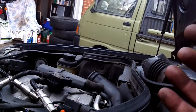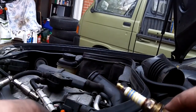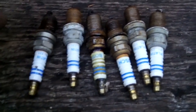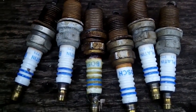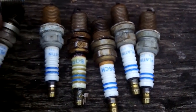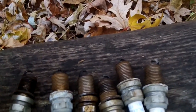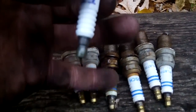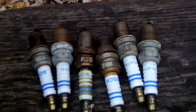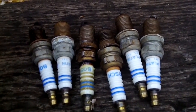I'm using corrosion preventative electrical contact grease — the stuff you put in electrical connections. Here are the six old plugs from the driver's side. Here's the new Platinum TT plug gap — the old plug gap is worn down, almost double what the gap is on the new titanium tip. About an hour to do per side on this car, so give yourself some time.